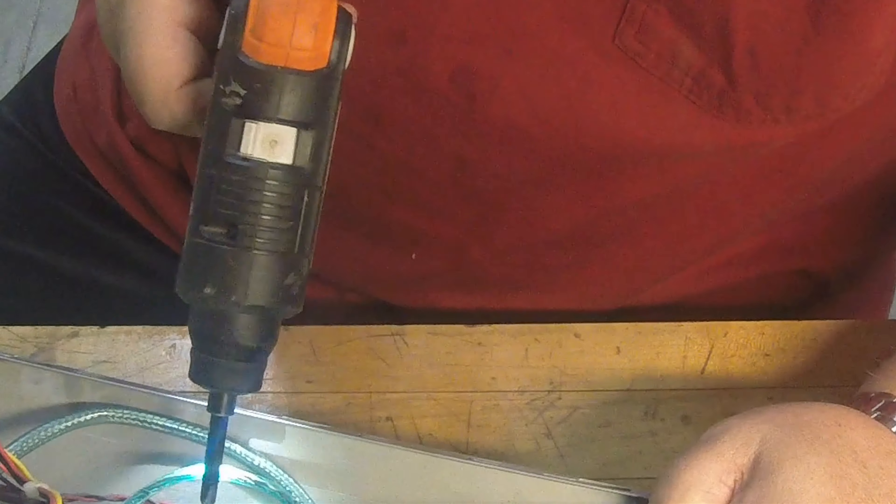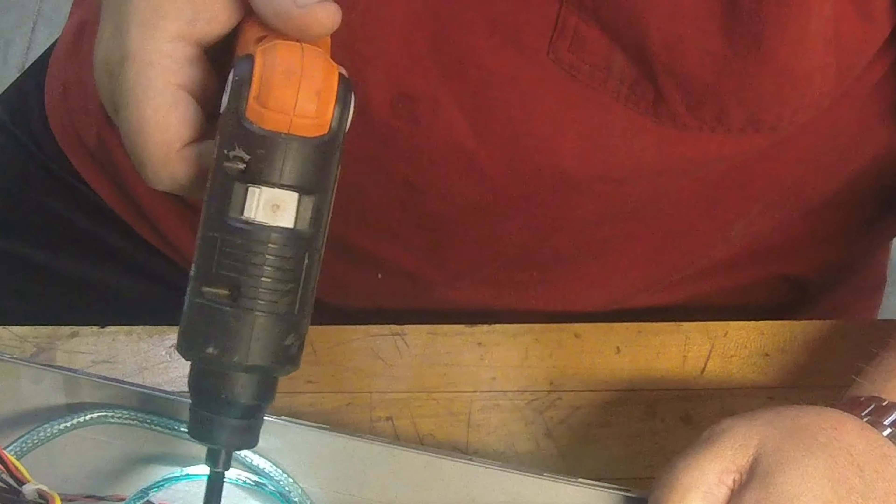I don't think it's got a speaker so I'm probably not going to hear any tones. But give it a drum roll — come on baby, do the trick. Yeah, we got nothing. That tells me it's more than likely the motherboard. There really ain't a whole lot else I can test — it's got an integrated video card and I can't even get it to post.